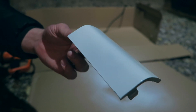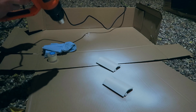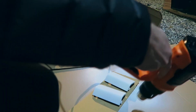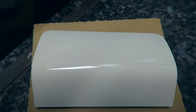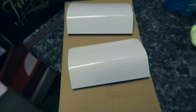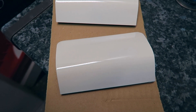I think you'll admit it's not a bad looking paint job. That's the three coats gone on, so now I'm just going to give them a quick dry and bring them indoors. After three coats and a bit of drying with the gun, this is what they look like. I think they look quite good, to be honest, though obviously I'm going to be biased because I painted them. I'm going to bring these indoors tonight, let them dry naturally, let the paint bond to the plastic, and then we'll come out tomorrow and put the lacquer on. I won't film that bit because that's boring - the next time you see these, I'll be putting them on the car.